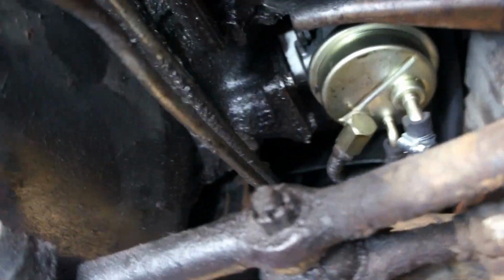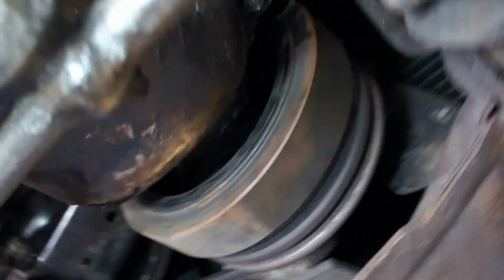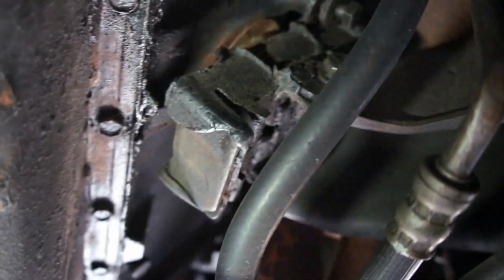Lots of oil leaks around the engine and a bit manky looking. That's the engine mount bolt that's hanging out, which I said to you on the telephone about. They're replacement engine mounts anyway, and they're not particularly good ones. We'll change those for locking engine mounts, which are a safer bet. Exhaust system is pretty iffy.